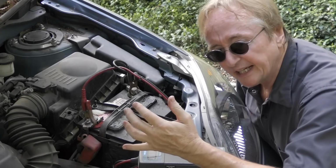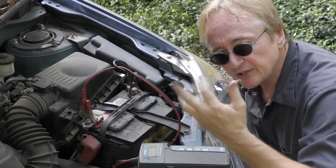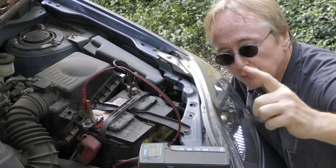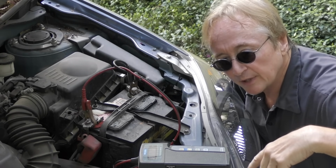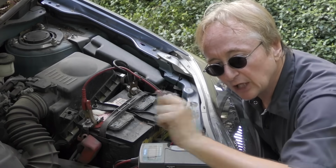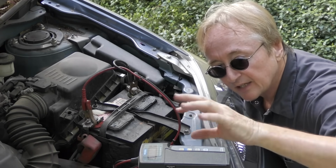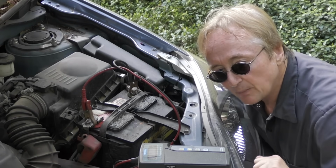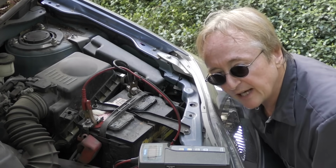Have the battery and alternator checked first. If your battery is weak, or your alternator isn't charging correctly, and this test takes about 2 minutes, then when you turn the electric motor on to make the window go either up or down, they use a reasonable amount of power. If the battery's low or the alternator's weak, it'll often make the car idle a little weird, or the headlights dim at night, and it's really not the motor, it's the battery or alternator not charging right.